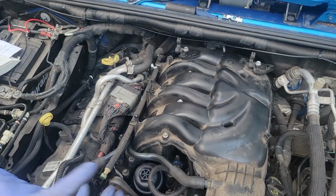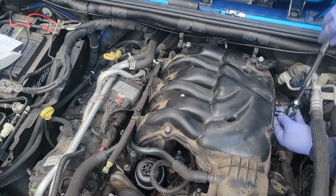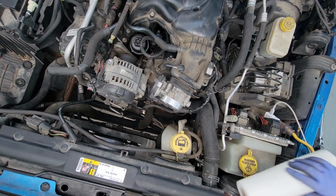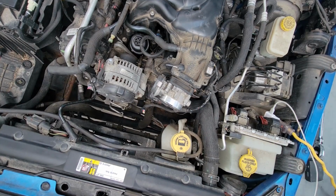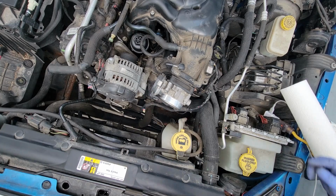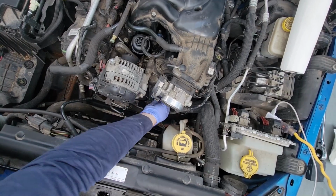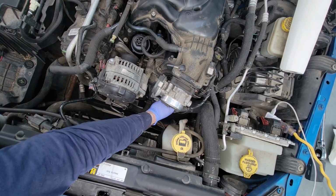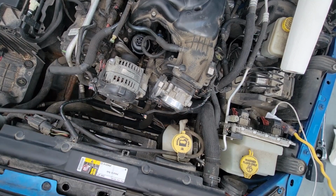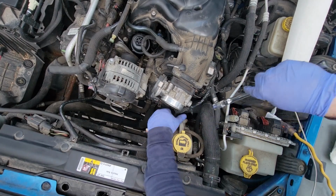Okay, we got 2 bolts over here to do. 2 nuts go right here. 2 nuts. Something tells me there should not be oil in the throttle body. I wonder if this Jeep has a lot of blow-by. There's 2 nuts down that go down here below the throttle body. One underneath this, right there. So there's 2 10mm nuts underneath there. Grab our ratchet and cinch them down.